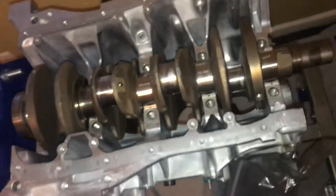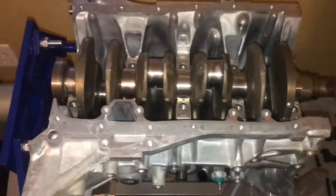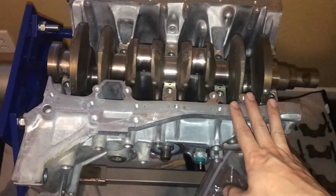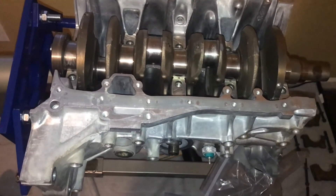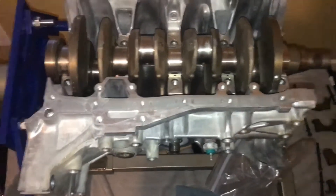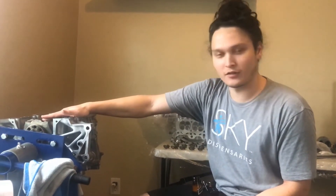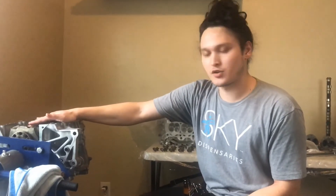This center journal is looking good — just a hair, possibly two or three hairs under the 0.038, so we're all looking good there. I'm super hyped that the OEM bearings and the color codes worked out from all the research I did. Let's get the crankshaft bolted down — I already got the bearings in place, all lubed up, and the thrust washers in place. Make sure you follow the color order that you found from the block.